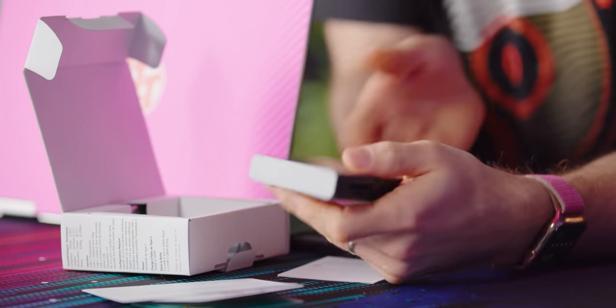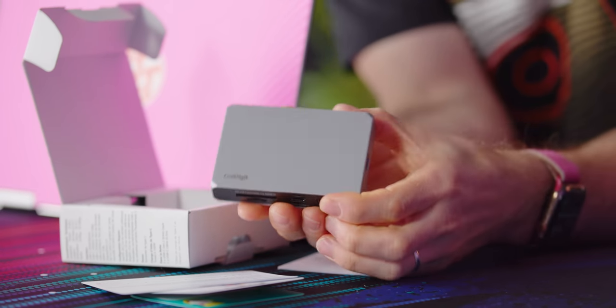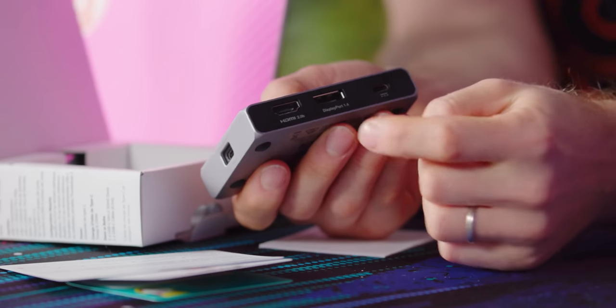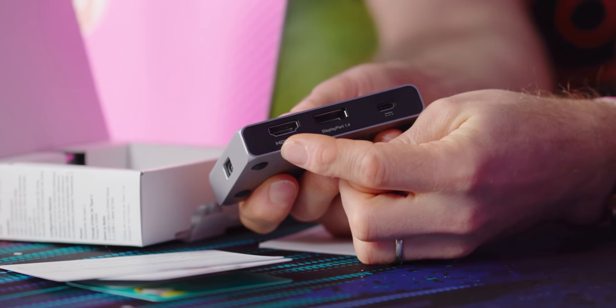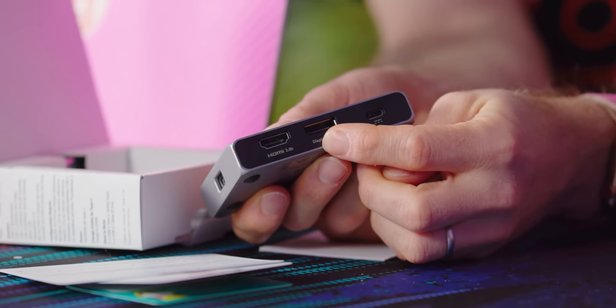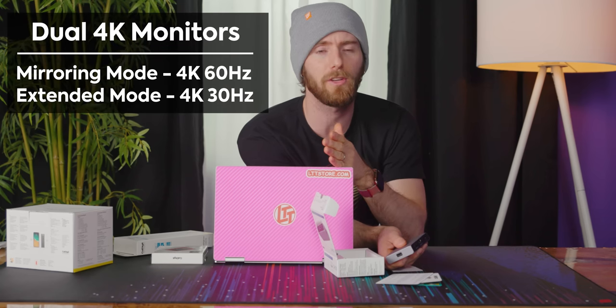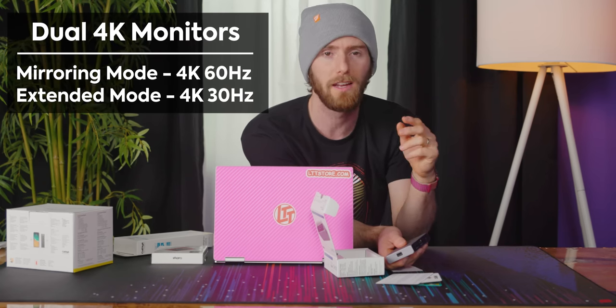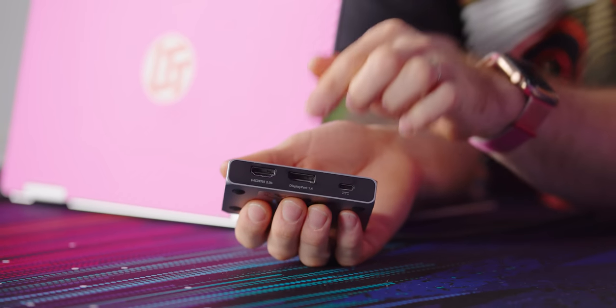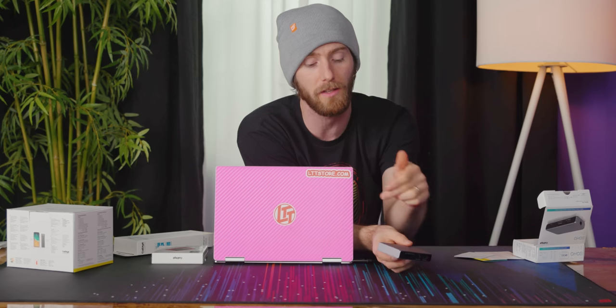So that means even if you've got a powerful machine, it can be charged while your adapter is also powering the dock. It's got HDMI 2.0, which means you can run 4K 60Hz with a single display, and DisplayPort 1.4 — so you can do 4K 60Hz there too, or run two displays up to 4K 30Hz. What's cool is that the display outputs use different lanes than the USB ports, so they're not sharing bandwidth — your USB devices aren't going to slow down when you're using display outputs.